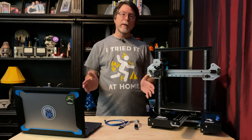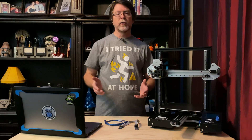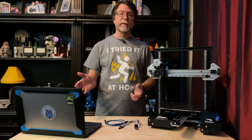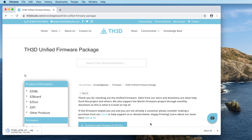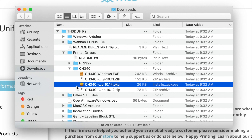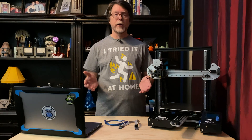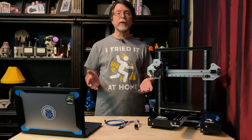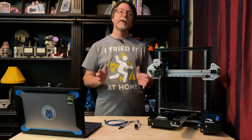You may also need to install drivers so your computer can communicate with the programmer to install the bootloader, and with the printer's mainboard so that you can install the firmware. Having recently done an operating system upgrade, I needed to install the CH340 USB to serial driver on my Mac, and my trusted source for this is TH3D Studio — this is included in their unified firmware package in the printer drivers folder. If you need the drivers, there's a link in the description. I want to give a shout out to Tim at TH3D Studio for all the hard work on the unified firmware. I'm planning on covering the installation of the unified firmware on the Ender 3 Pro in a future video, but for now this video is all about the bootloader and the Creality firmware.